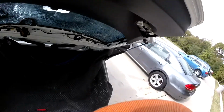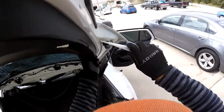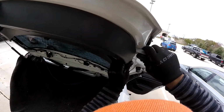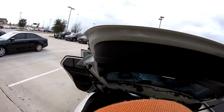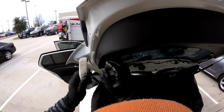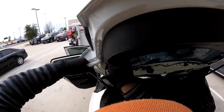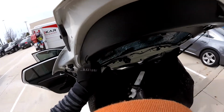Before we start cutting, we're going to remove this area. Remember, you can see the clips here, the same as the other panels before. Just carefully. Try to open it in one time, the whole area, because sometimes these kinds of panels bend, because the clips are really weak. You see, it's really soft. So just carefully